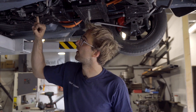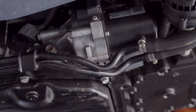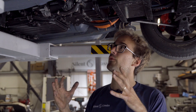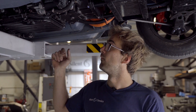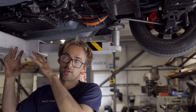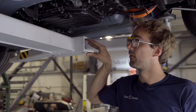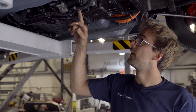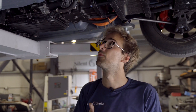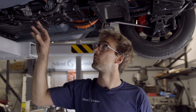This little guy here is an electronic oil pump. Without this oil pump, this whole drive unit would not work in this application. You need high pressure oil to feed all the clutch packs and all the gear reduction going on inside the gearbox - there's also a gear reduction built into this drive unit, which gives you the right RPMs out of the output shaft. In the original application it would kick on when the engine cut out, but we're running it continuously now because we need the hydraulic pressure, and it seems to be working really well.